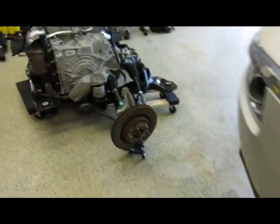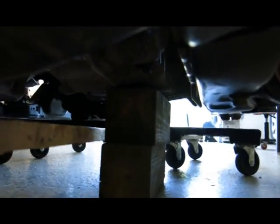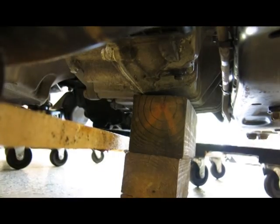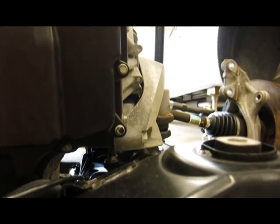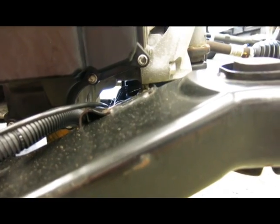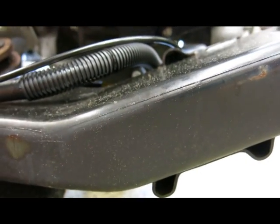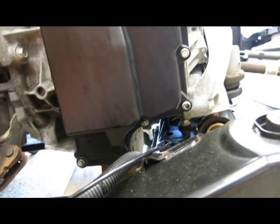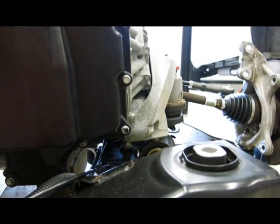What I've done so that we can take that mount off without everything falling down is I've supported the transmission — the transaxle — directly to the floor. You can see there are some blocks holding that up. When I take this all off the frame might drop a little bit but everything should be okay. If you're doing this in the car, you have the car up on jack stands but you'll need to support the transmission separately so it doesn't fall down when you pull the mounts out. So I'll set up the camera on the tripod and get to work.